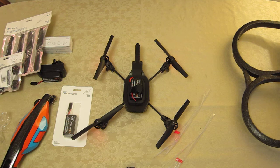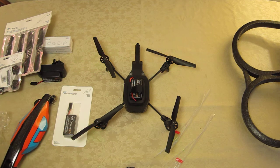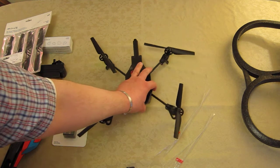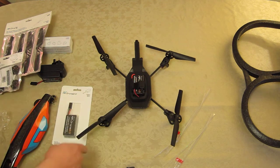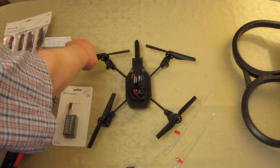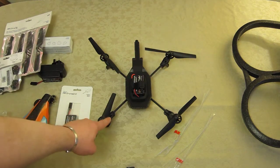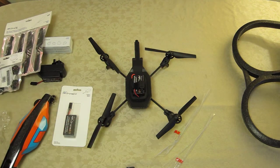It will immediately do some quick tests — you might see a little glow with some red lights coming from the LED corners, and each blade and motor will do a quick test to check that they are working fine. Even when the unit is powered up, turning and twisting the propeller blades both ways to feel — and it is about feel as well as listening — to make sure that all the gears and cogs are connected is a really good tip before you take off.